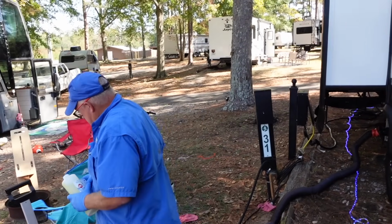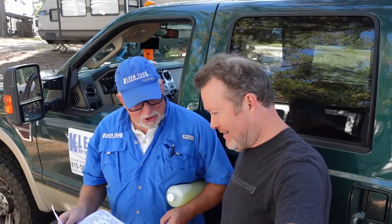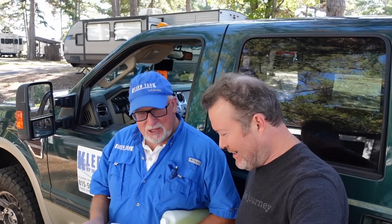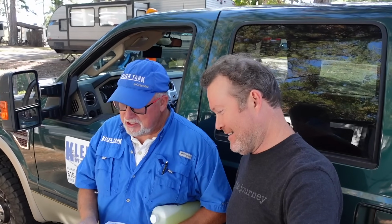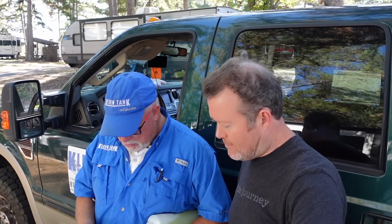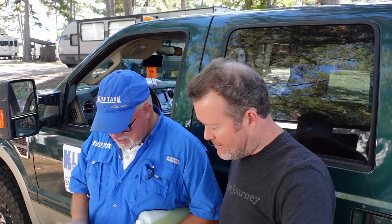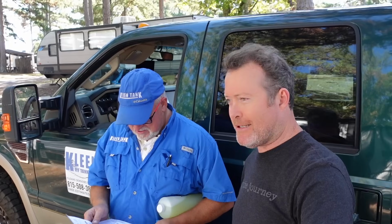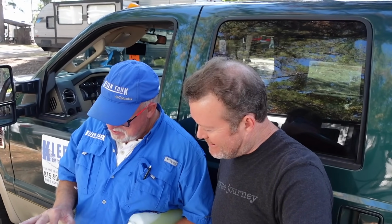Okay, awesome. We'll look forward to using that. So we've cleaned you up. Hope you don't mind if I share with the world how you did. You got a C on the black tank. You got some really heavy debris. That's three years of stuff building up from using a tank additive that breaks down or dissolves stuff. That's kind of a no-no. Your number one gray tank, that's your shower or your shower galley combo, a B in there, a little bit of mold, but not something too bad. That back combo tank, you got an A on that one. So an A, a B, and a C. And your water heater, you got a B on there just because there was some buildup in there. Make sure you're doing that quarterly maintenance on it.